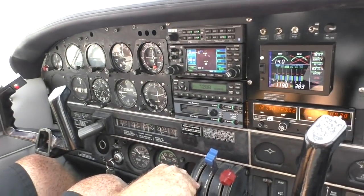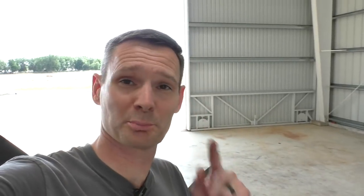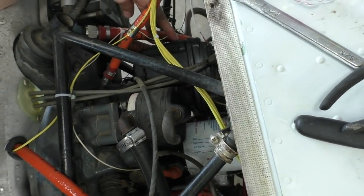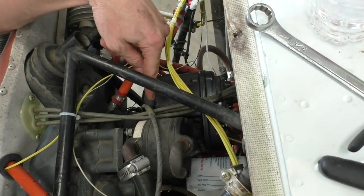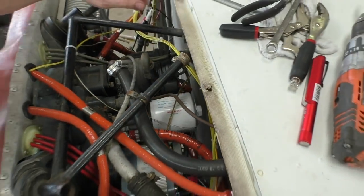Just a couple little things — not bad for touching everything on the airplane. The RPM sensor — it looks like it goes into the other vent plug. Here's the mag, there's one vent plug on this side, and then there's another one buried way down in there. I also noticed that my vacuum pump only had three nuts on it — it's missing the one on the bottom, and that one is all old and busted. Jason had a really nice one in all that stuff I bought off him, so I'm going to put the newer, nicer one on there. Thanks Jason — you are rocking this project out. Once again, saved the day!